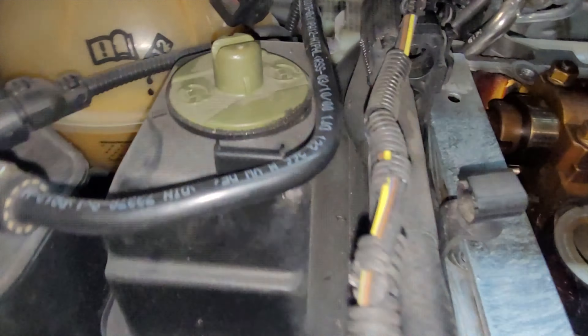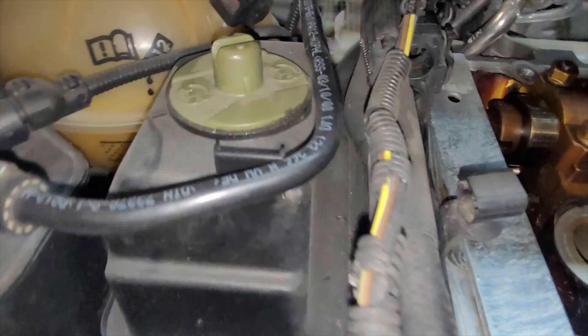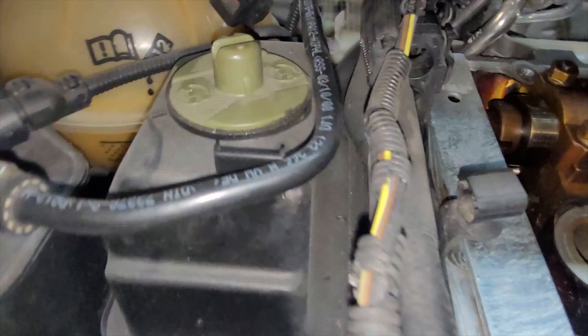Make sure the plate is actually hanging over the edge on each side of the head, just so when you're undoing stuff, if the cam does move, the bar won't slip out of the way. And there's my spanner on the cam for me to turn it if I need to. Thirdly, you have a ground-down tooth on the crank on the passenger side of the engine. As you can see, it lines up with the join on the lower part of the engine — I think for the crankshaft cap. So always make sure that's lined up as well.